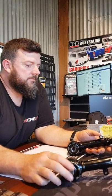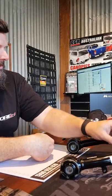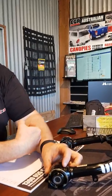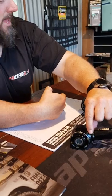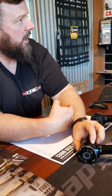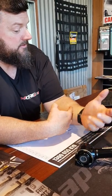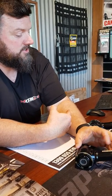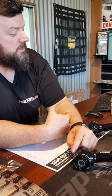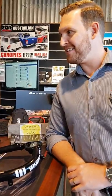On a couple of different types of arms, we'd seen a butt weld to the bush carrier — just welded basically at the base of the tube. And some other manufacturers, after some failures where you'd get tube and bush carrier separation, then started putting gussets on the top, just welding on extra strength to cater for the weakness.